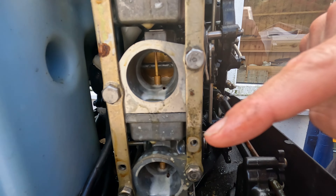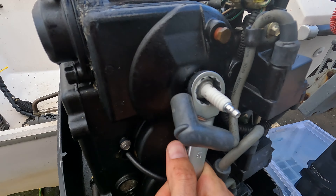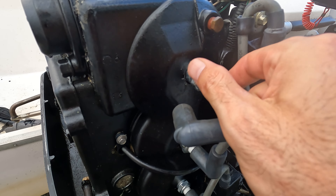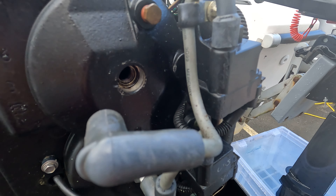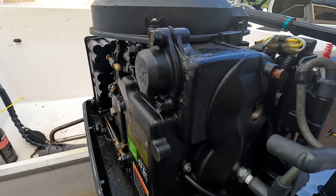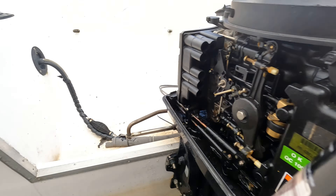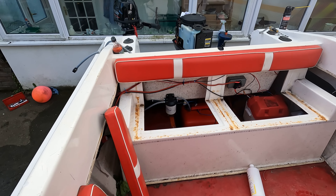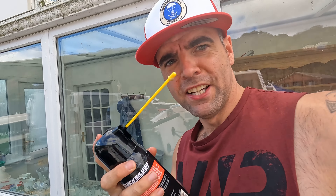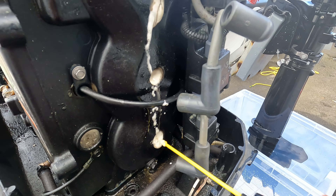She's run out of fuel — I opened up the carb inlets to allow it to get through. I'll put the air box back on and then get to the plugs. It's also a good time to have a look inside — it's not too unusual for a two-stroke to be quite rich like that, especially when you've just run it out of fuel. I'll squirt some fogging oil in here. It's important that you cover these up so the engine doesn't draw any air in — give it a quick turnover and that will lubricate the cylinder. That's all we need. Then lastly after the turnover, put the plugs back in.